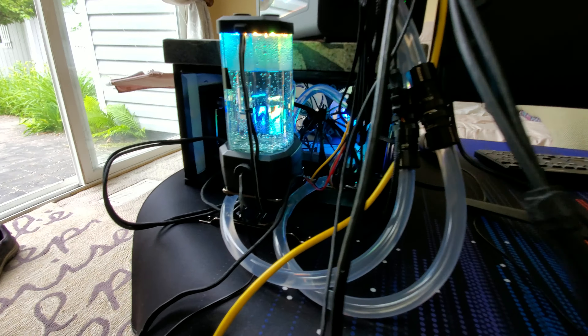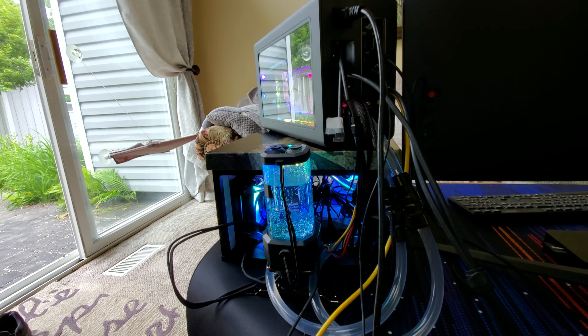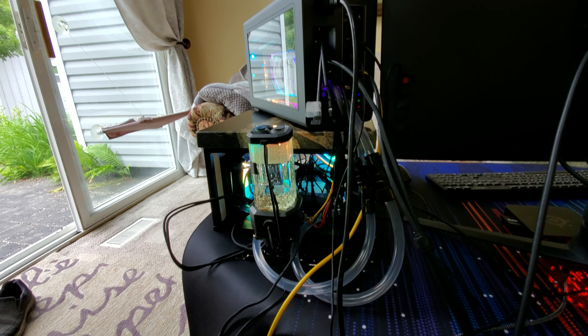We have a Corsair XD5 pump. I was originally going to use two DCLT 2600 pumps with the Ice Station 40 reservoirs — one inside the case and one outside — so I could run the loop disconnected from the base using just the 120mm radiator inside. But at the last minute I decided not to for two reasons: one, how often am I going to use the computer lightly enough for a 120mm radiator to cool both a Ryzen 9 5950X and a 3080 Ti; and two, I didn't want to deal with bleeding the air out of those little reservoirs. So I went with the big one. I may update this in the future when new parts come out — I'll go hardline then and put the smaller pumps inside the chassis.